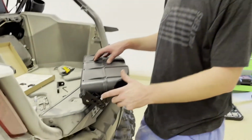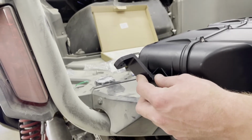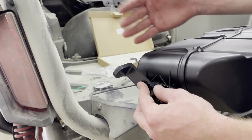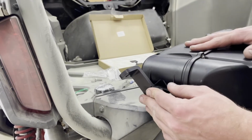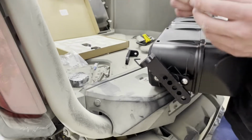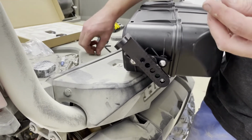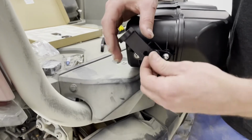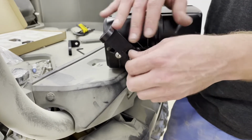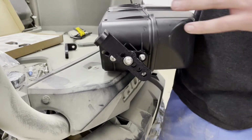With the pivot bodies installed, we can now get the L brackets in place. This is gonna come down to how you wanna mount this on your vehicle. I'm gonna tuck it really tight to the upper roll bar, so I just want barely any clearance here, and I want it backwards a little bit so it doesn't hit my helmet. This really all depends on your specific application, what accessories you have in your bed. So once I get that in place the way I want it, again, more blue Loctite, the thick short Allen here, and then a washer. And we'll get this ran in and snugged up, and then make sure we do the exact same alignment on the opposite side so that the separator sits level.